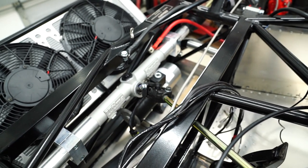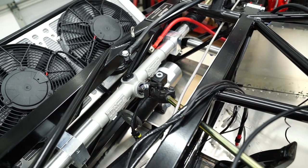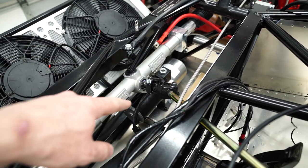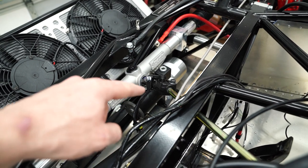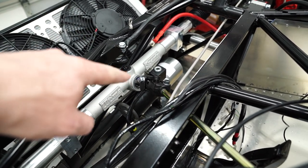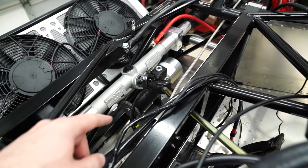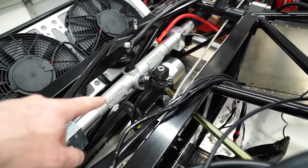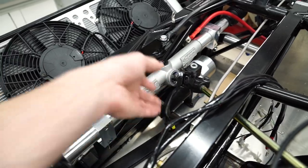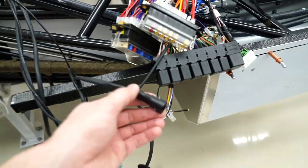All right, so there's a lift pump installed right there, just below the steering rack. Very straightforward install. Just three holes, put rivnuts in there, and then I have some M6 screws that go down in there that hold the little aluminum base, and then that little aluminum base screws on the bottom with some countersunk screws into the reservoir and pump. And then we've got just this little clip right here that then will connect to right here.